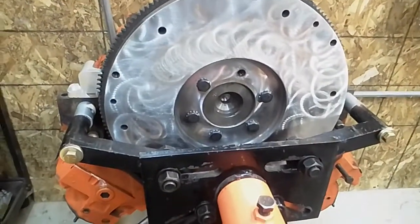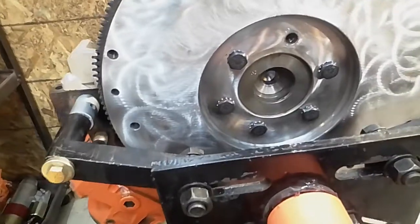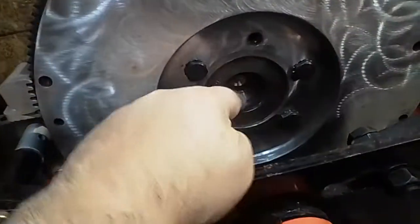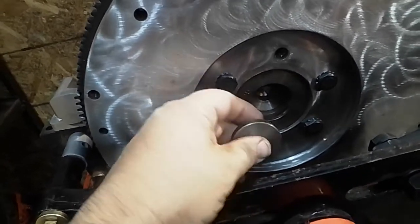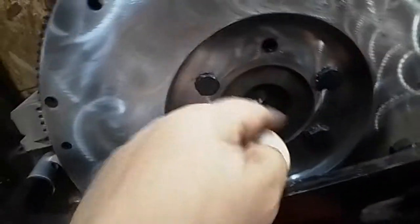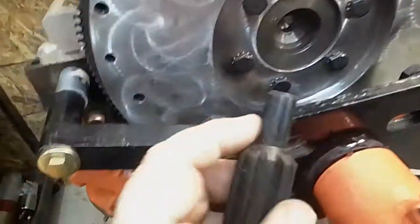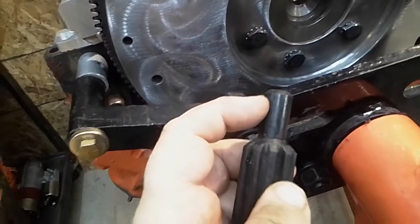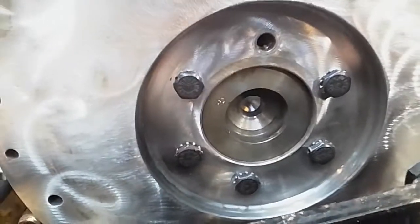I just converted this one — this motor is fully assembled — and yes, there's a hole in there, and I used a hand drill. I know you're thinking it needs to be a precision hole, but it's not. What I'm using is a bushing made specifically for the Cadillac that centers on the factory machined surface for the torque converter. Once you've got this in there, it's centered on that surface. The hole I drilled with just a hand drill is strictly for clearance, so if the nub sticks beyond the pilot bushing, it won't bottom out on the crankshaft. You could technically cut the nub down a little bit, but it's easy enough to just drill a clearance hole.